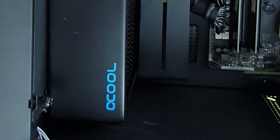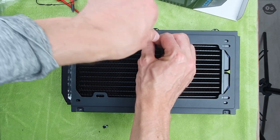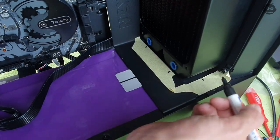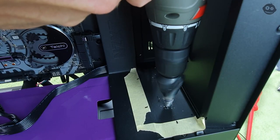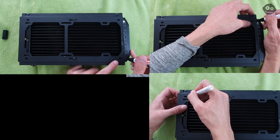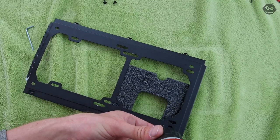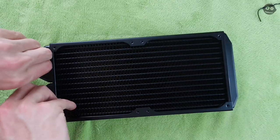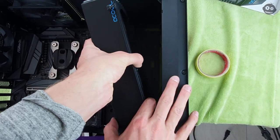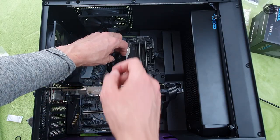Then we had to flatten the front plate so that the radiator sits snug against the case. I marked the holes I had to drill on the radiator back plate with a marker, and also marked the holes for the throughput connectors into the bottom segment with a pencil. I drilled small holes, then widened them to around 30 millimeters so the fittings could pass through, cleaned everything carefully, and added more holes with the right size drill to the back plate so I could screw down the radiator safely. The transport plugs were removed from the radiator and the holes plugged with screw-in fittings delivered with the cooler, then we could test fit the whole thing into place for the first time — which was quite tight.